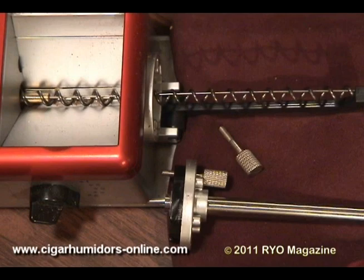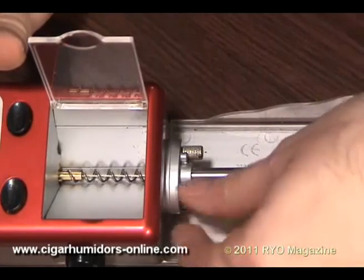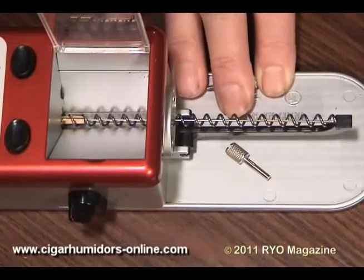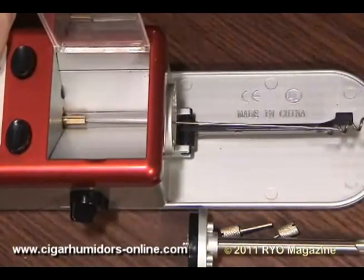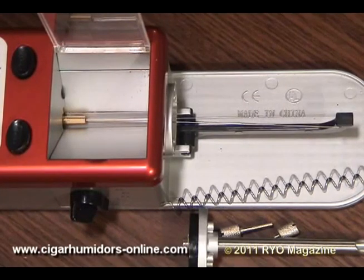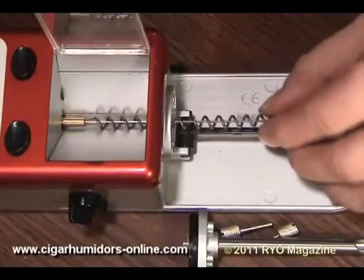We'll have to disassemble the machine a bit to show you the wire, and the disassembly is quite easy. Here's the wire — it is attached directly to the motor and is independent of the auger. Loosen the little knurled knobs; the first time you might have to use a screwdriver in those little slots, but after that only finger tighten them. You never need to screw it down hard. Slowly slip the nozzle attachment off, then pull the auger out — holding onto the back of the machine, gently pull forward. The auger comes out and now you'll see the wire. We don't recommend you do this often because it could damage the wire, but we want to show the revolutions of the wire with no auger there. You can see how wide the path it cuts. That will be happening inside the auger, keeping the tobacco loose and keeping it from binding up and being broken up and crushed.